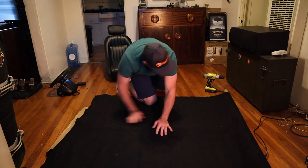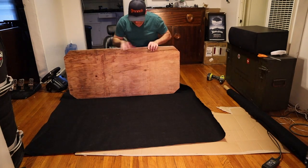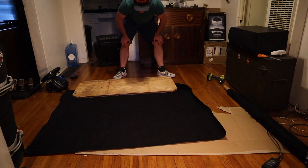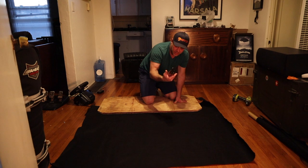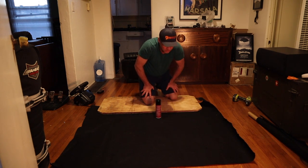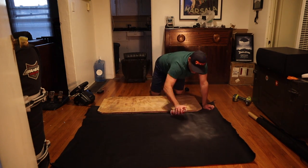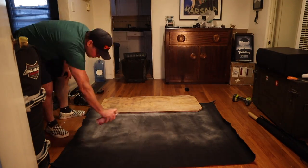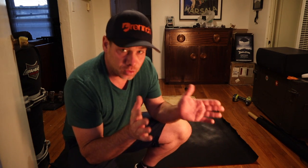Everybody has their own method for this. What I like to do is get it set up so I can just drop it and lay it flat. That way I can spray it and then spray the piece at the same time. For this I'm using Super 77 from 3M, which I got from O'Reilly's. Then this is the felt - I will link this felt up in the description below. The technique is: spray each surface and get them nicely coated, then wait until it gets a little bit tacky but feels almost dry. When you contact them together, they have a great bond.